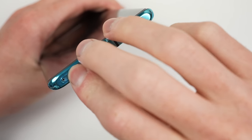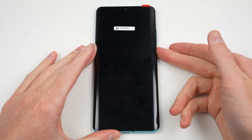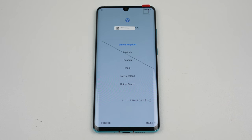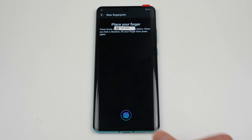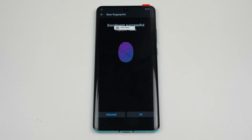After cleaning off the motherboard and camera lenses, I can reconnect the battery and the wireless charging coil that sits on top. The remaining Phillips head screws can then be reinstalled. Having put the SIM tray back into place, the phone is ready to be tested. Pressing the power button, it took a few seconds to light up, but once booted came the moment of truth — does the touch work? Sure enough, the issue has been resolved with a new display. I could proceed by setting up the phone and testing its functions.